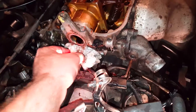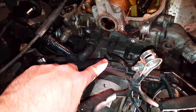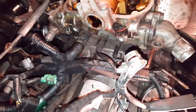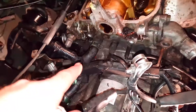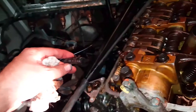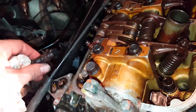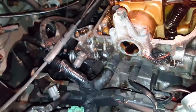What happens when these go bad is the hoses underneath get leaked on so much that they actually start getting rubbery, then they split and leak, and you get coolant leaks — which is actually why I'm doing this. These Hondas use little coolant lines that go all the way down the back. This is the one that broke — it's a 5/16th hose, really small for a coolant line, but they have oil coolers on them.